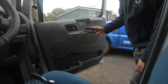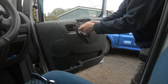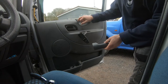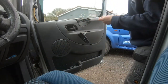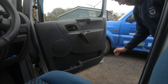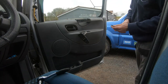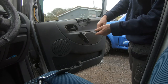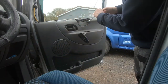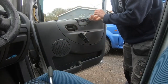Okay, so I've got that switch out for the window controls, that panel off there, and the bolts around this whole handle, then start to unclip that off. There are two 10mm bolts — well they'll be 6mm but a 10mm socket to fit the head. Bolts removed from there, unclip this all the way around. Now this here is a handy tool I got from some sort of car fair — it's good for getting clips out, getting panels off. Sometimes if you try with a screwdriver the clips just snap. These seem to get them out really well — good investment. So I'll take these two bolts out and hopefully this door card will lift off.